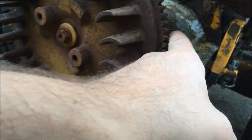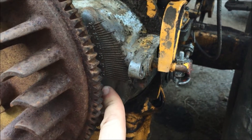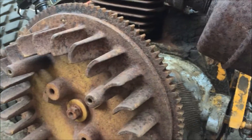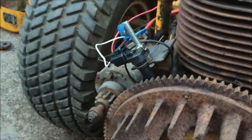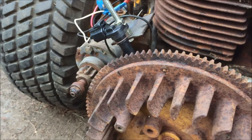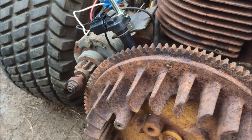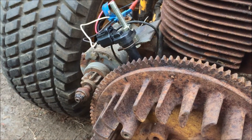My timing is off about 40 degrees — I'm supposed to be at 20 degrees before TDC, but the timing light was showing it about 20 degrees positive. I've got to figure this out. I'm going to take the sensor off, make a big slot in there with a round file, put it back on and start it up again to see where we're at. It's so far off that I may just bring it inside and drill another hole about a half inch down the line.